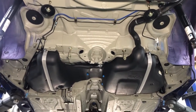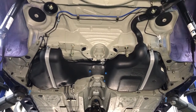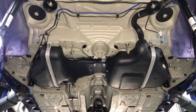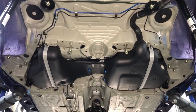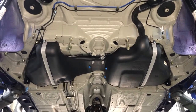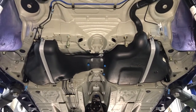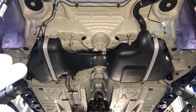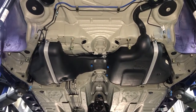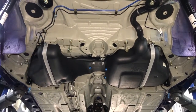You can see the fuel tank has come up like brand new. The tops of the fuel tank, including all the fuel vapor pipes, have been extremely thoroughly cleaned and separated, and so has the underside of the fuel tank, along with the tank straps being installed. Those are powder coated — even though they are stainless steel, we've powder coated them to give a stainless/gray contrasting color against the black tank itself, so they've got extra protection. The bolts, rubbers, and sleeves have been installed into the Reedus Motorsport fuel tank brackets.